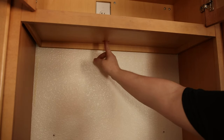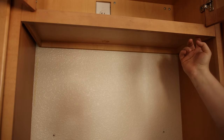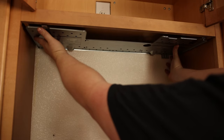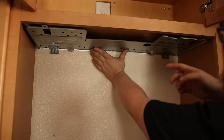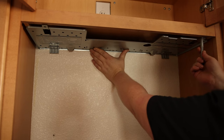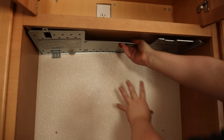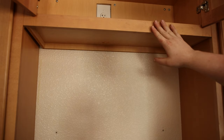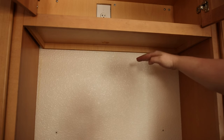I'm just gonna use that center hole for the outlet, but the mounting holes are in the wrong spot so I'll have to cut those. We just gotta get it centered. The way they suggest is to mark the center line in the cabinet and match it up with the two centering arrows. Things to be aware of when lining this up: if you have a backsplash on the wall the microwave will be a little further from the drywall and you may have to pull this out. And if the front of the cabinet has a lip, the entire microwave has to go down to meet that lip.